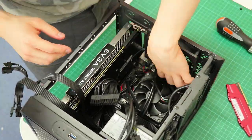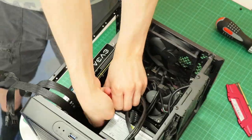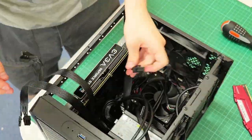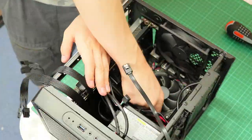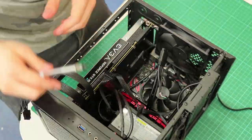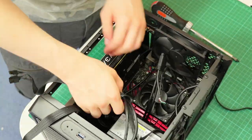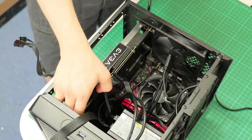There's absolutely no way that a 280mm card can fit in this case without modding. I've got only 3mm of space to the rear of this card. So if you trust me and you're getting this case, get a card that's 267mm or smaller and expect some scraping at the 267mm range.